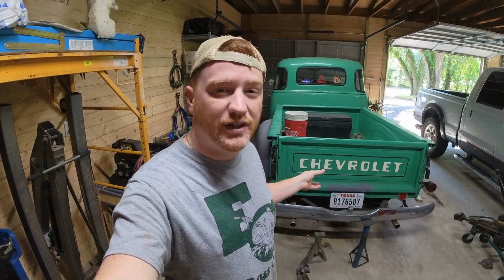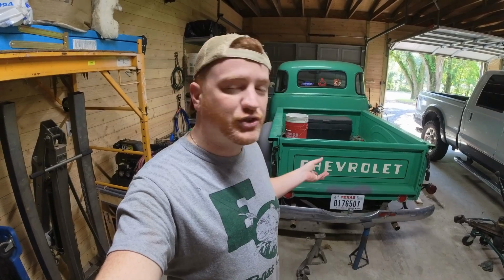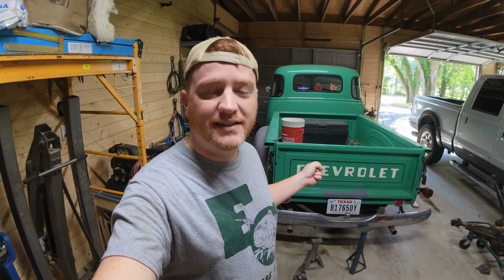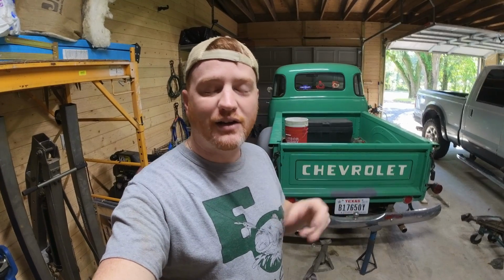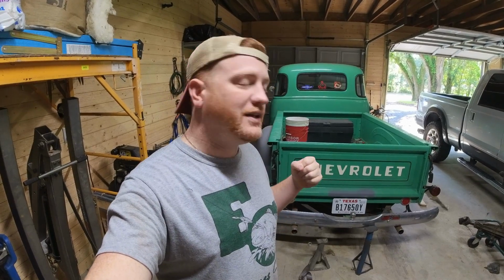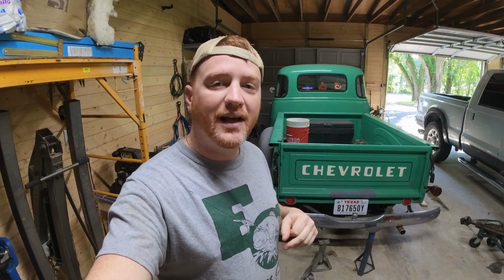These trucks either came with a 390 or 410 rear end. This truck has the 390, I believe, but it has what you call a closed driveline. That means the drive shaft, transmission, and rear end make up that closed driveline, which makes it very difficult to get lower gears to make this truck go freeway speeds, and it really limits how you can go about getting those speeds.